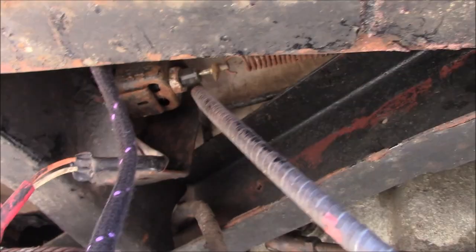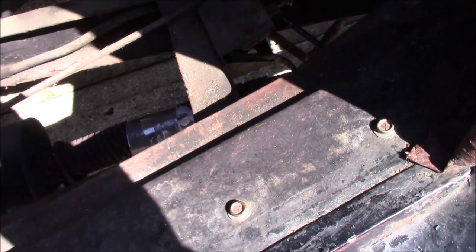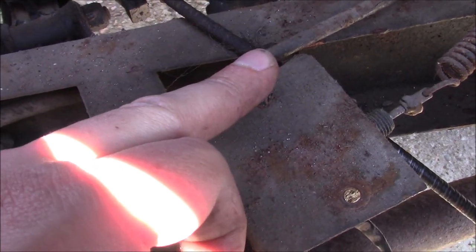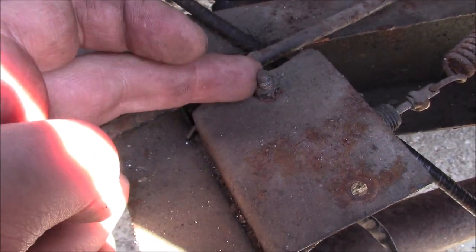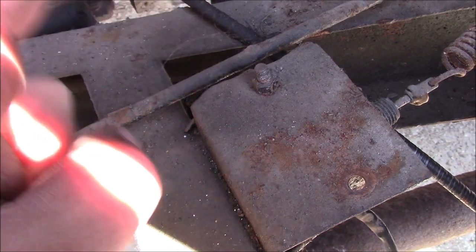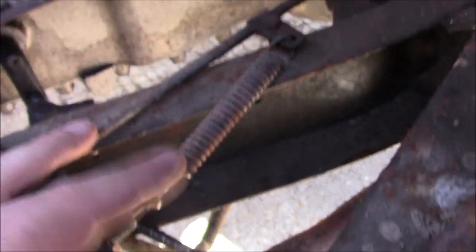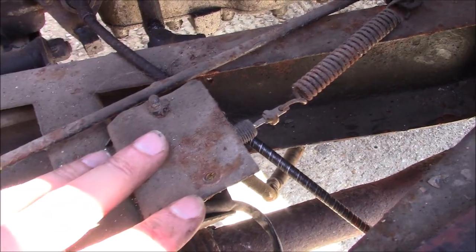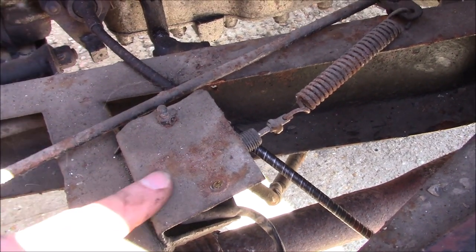So I'll get this off and see what we're dealing with. Now I've done it a few times, getting the floor out isn't too difficult. This is the brake switch bracket — I can't get anything other than a spanner on the bolt on the other side and you can't move the spanner, so you have to undo the nuts from the top. They're not captive, of course they're not, and disconnecting this spring would have been tricky because you can't really access that from underneath the car. I'm going to quickly pop this out — the door keeps shutting on me so I can't record it — but we'll have a look at the switch once it's off.